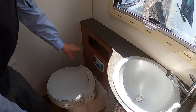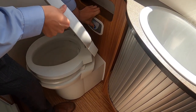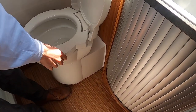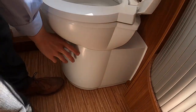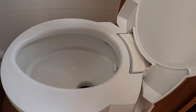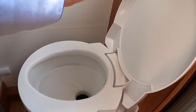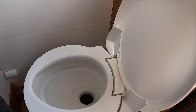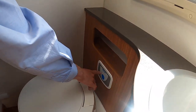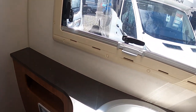In your bathroom, press the big blue button on the back of the toilet and you'll get the flush — should the pump be on, it will flush. You've got a cassette with a slide or trap door — if you slide it to the right it deposits waste into the cassette. The slide must be shut to get the cassette out for changing. The indicator on the diagram will go red when the cassette is full and needs emptying and replenishing with chemical.